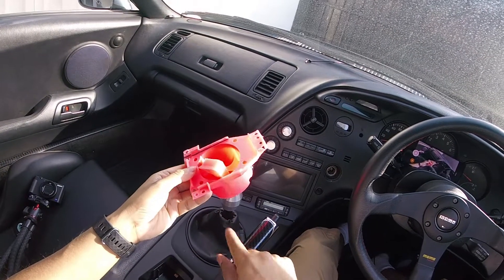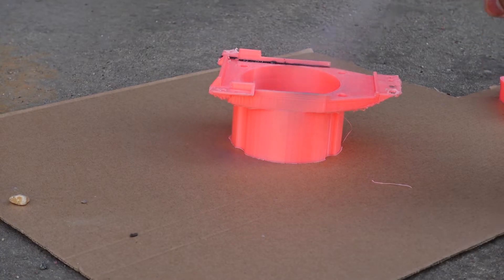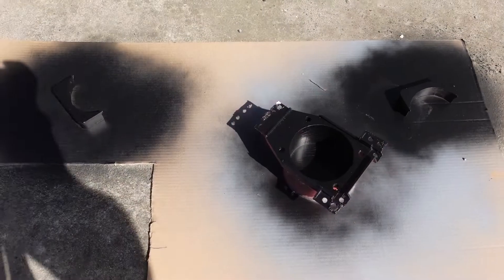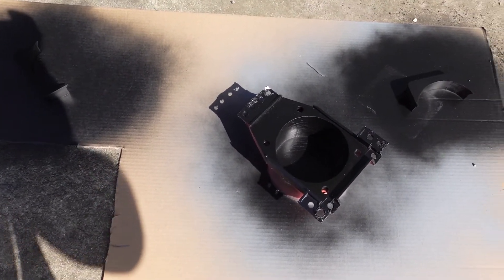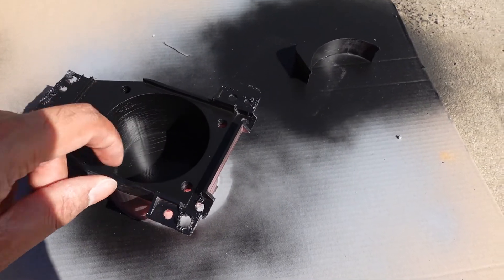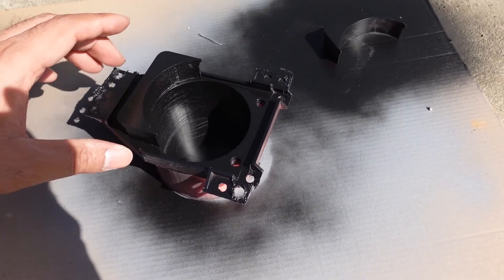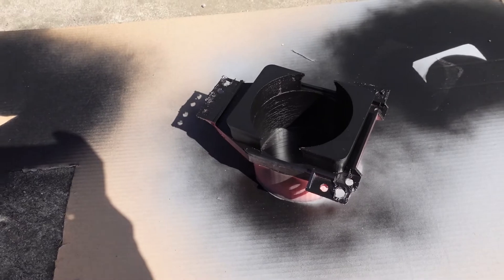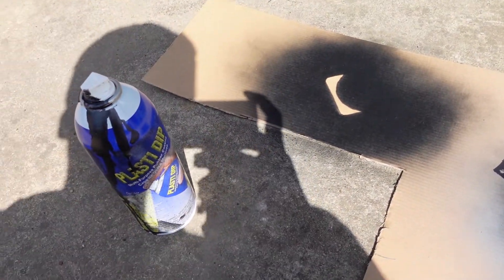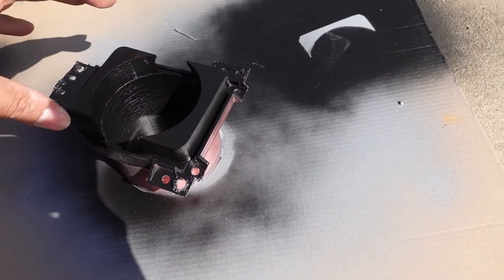The links are in the description if you want to use the same file we used to print this. It's now painted — I finished the primer stage and then gave it a coat of satin black so the internal bits got some black on there. These are going to be the bits on show once everything's mounted, so this is the part I'm going to concentrate on now to give it a close-to-factory finish. We're going to achieve that using plastic dip paint, leftover from an earlier project, giving it a few coats for that nice textured feel similar to OEM.